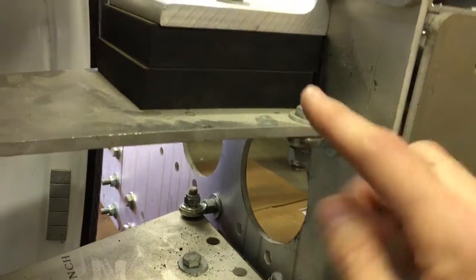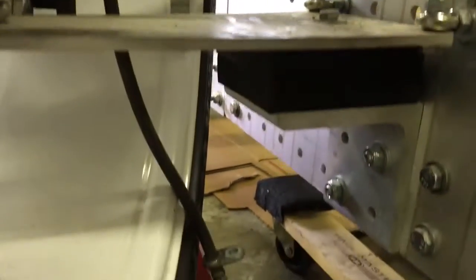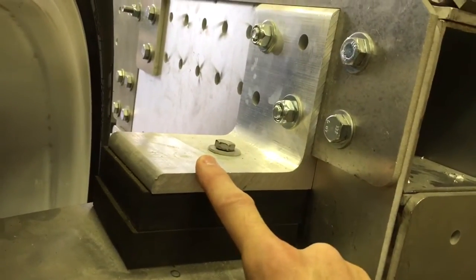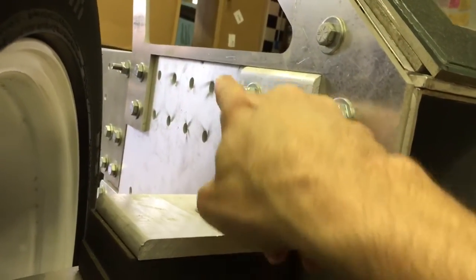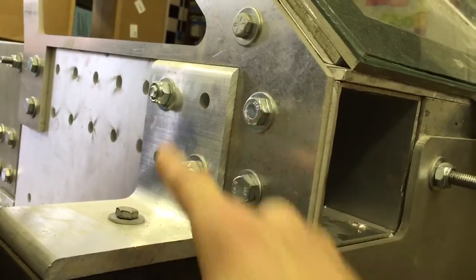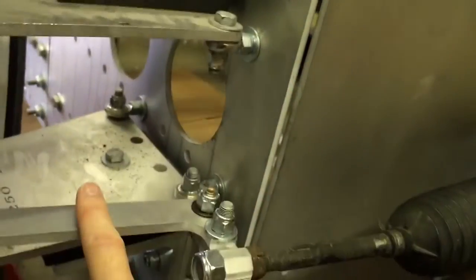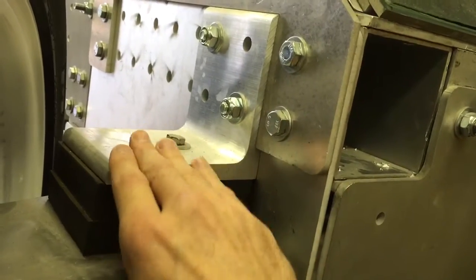That should get your two A-arms attached. Then attach your two rubber bushing blocks on top and on bottom. A bolt threads through here with a lock nut and a washer on top and bottom. This is the strut top mount — it compresses the bushing blocks. It connects with any two holes in the top and bottom row of the suspension, in the second and third holes back. You can use any two, or install all four if you wanted to. There's a washer on the inside and outside. Now you should have your two A-arms, your two bushing blocks on the top and bottom, and your suspension mount plates compressing the bushings.